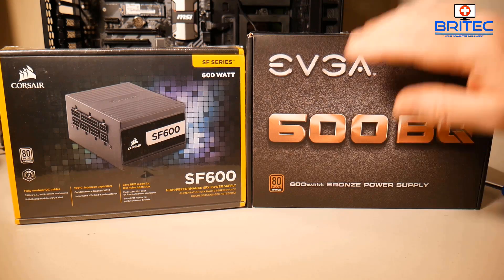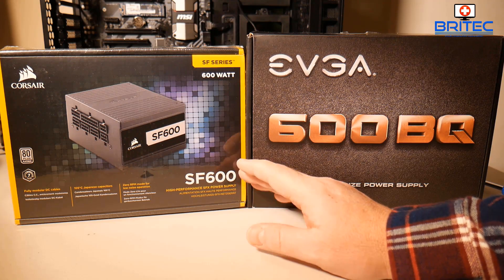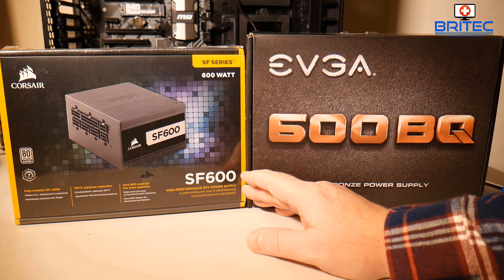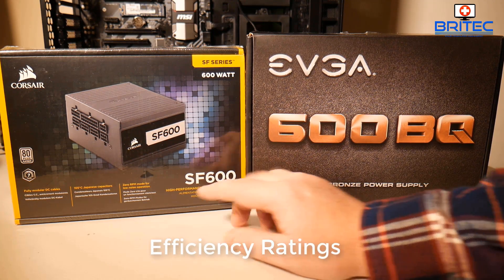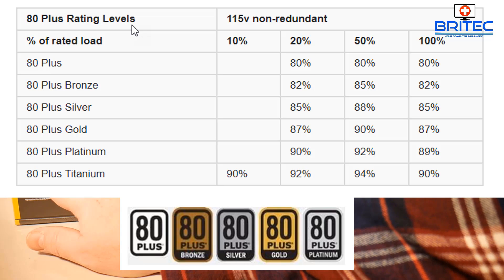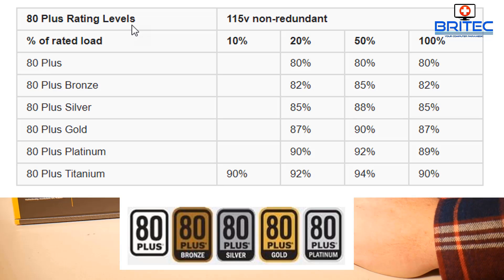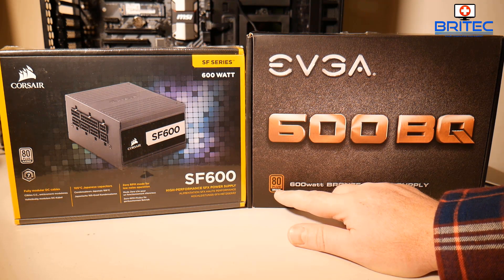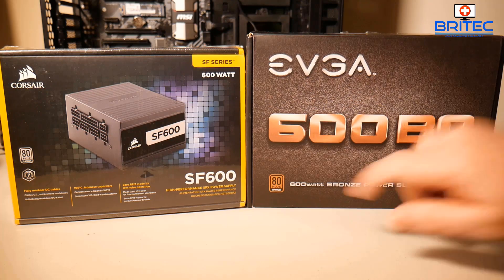Let's take a look at rated power. This is an SF 600-watt platinum-certified power supply. We need to look at the efficiency ratings — you can see the 80 Plus tiers: Bronze, Silver, Gold, Platinum, and even Titanium. Platinum and Titanium have 89% and 90% efficiency ratings under 100% load, which is excellent. 80 Plus Bronze is good enough for most builds.